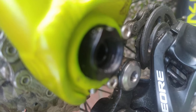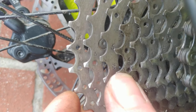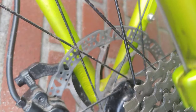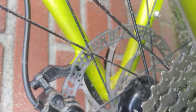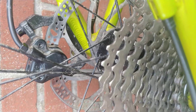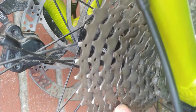The biggest sprocket I have is 38 tooth, but 28 is the most I've used. There's also 32. What's nice about this cassette is the sprocket differences are two teeth each — it starts 11, 13, 15, 17, 19, 21 — so when you're climbing a steep hill and you shift a few gears it's a small manageable jump. The spacing is good when you're climbing hills and going downhill and climbing again.